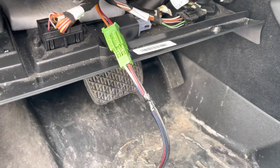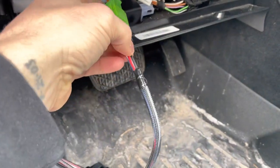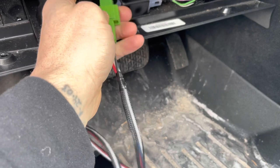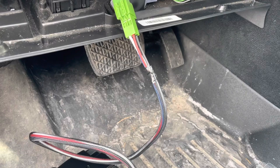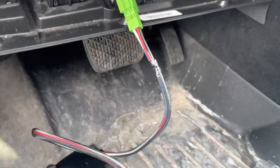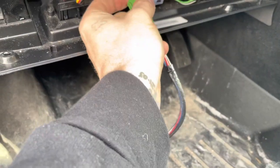Based on the diagram, all these wires line up. Our white is our ground and that goes to the brown wire, which is the ground wire. Our black is the fused trailer brake — this is going to be your battery feed and that goes to the red and blue wire. All these line up. The red wire on the harness goes to the black and red, and that is going to the correct place. That's our vehicle stop lamp and the blue wire goes to the yellow.